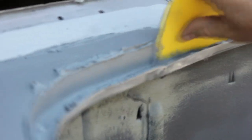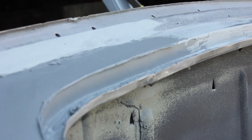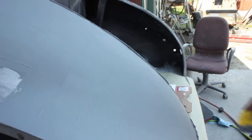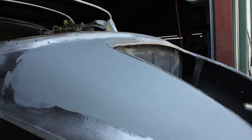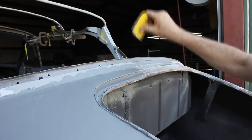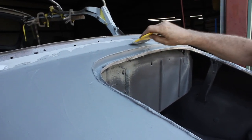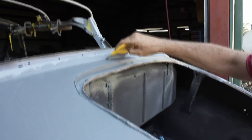Just spreading all the lead would take you every bit of one day to get all the lead taken care of and everything clean and laid. Then it would take you another day or two just filing everything you put on, and it's rather difficult to go back on. You can go back on it, but you might end up with pockets or voids doing lead. This epoxy is a little more forgiving. It does sand like lead — it's amazing the way it sands — because you can file it with a metal file more than you can sand it with sandpaper. It's very hard to sand with sandpaper, but using a metal file and metal wraps that you use doing lead works very well.